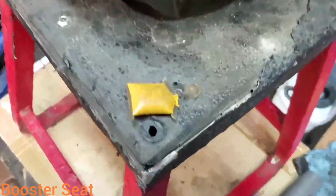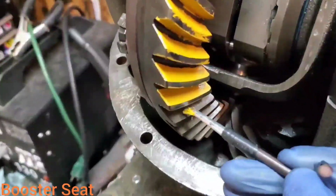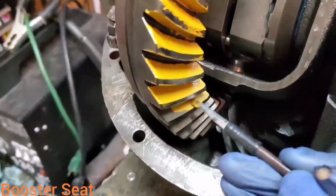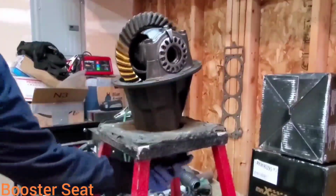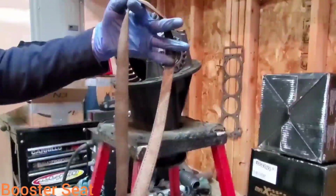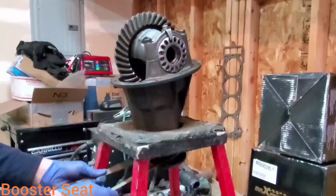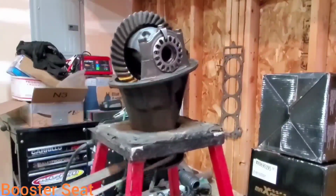And if you really want to get carried away, they got this gear marking paste, and what you do here, boys and girls, you get all B-Ross on it. Paint it up real nice. Just rotate it down into the pinion, right in the middle. And then we're going to take a strap like so, put it around the pinion, and you're going to just get after it.